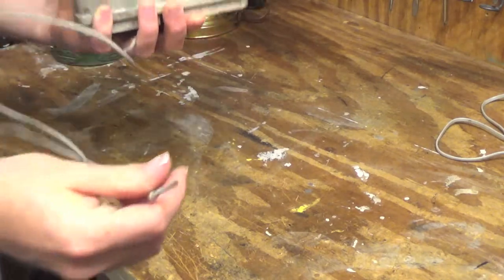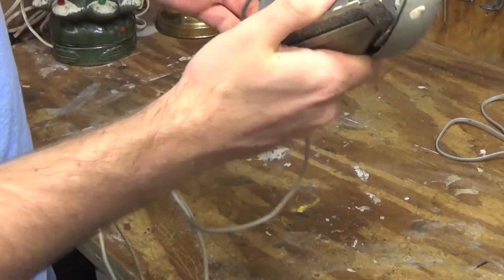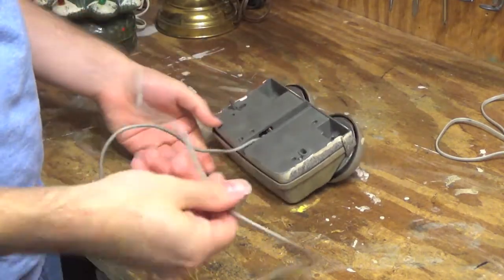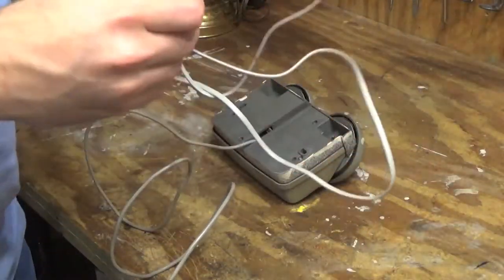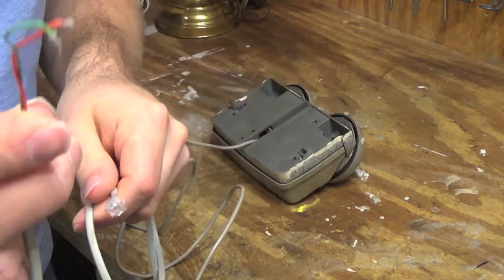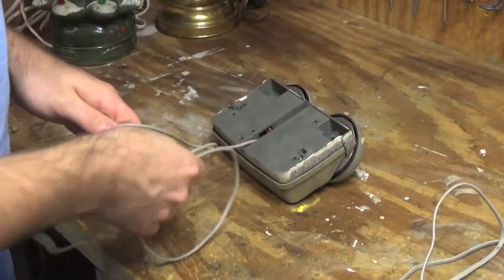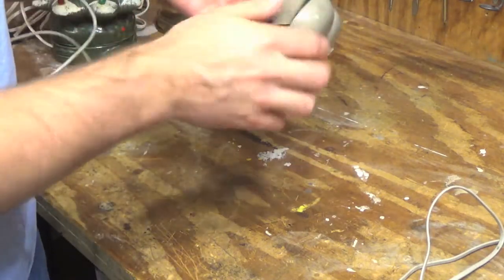Based on the wiring scheme here it looks like it was just cut out of the phone system one day. Going into there is only a red and a green wire. So what I'm going to do, rather than try to get a modular plug on this, I have this cord. I don't really remember what I used this for but it's a modular plug and it just has red and green on the other side. So I'm going to open this up and attempt to just rewire it.